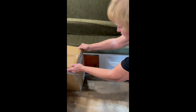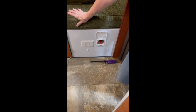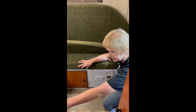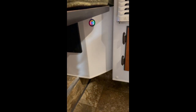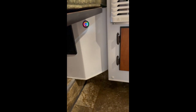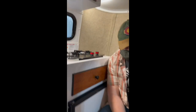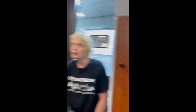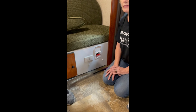Right here at your door, this is your battery shutoff cover. If you're going to store your trailer, underneath here you're going to notice a colorful little dial — that is your volt meter. That volt meter is what you're going to watch if you're boondocking and using a lot of battery power. It will tell you where you're at, how much voltage you have left, and when you're going to need to hook up and recharge. That and your carbon monoxide detector over there will drain your battery if you leave it stored for a period of time. So we recommend putting this in the off position — that shuts everything off within your trailer so nothing can drain your battery.